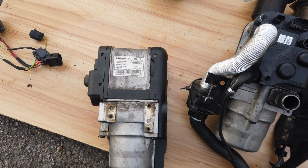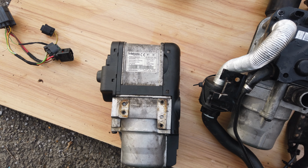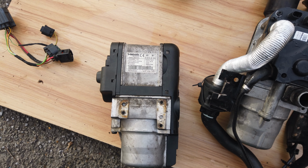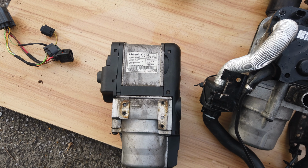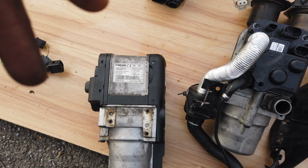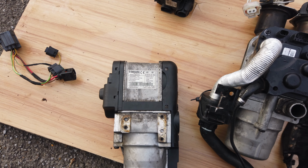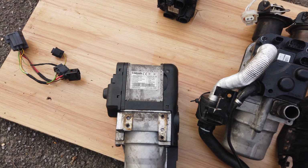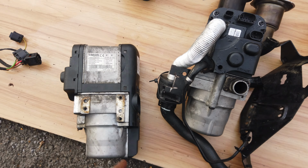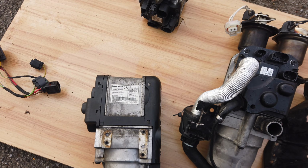Now in this situation the engine is already running, so the heater doesn't need the heating independent circulation pump. It depends on the car's circulation pump, which circulates coolant around the heating and into your radiator and into your engine block. But in parking mode, if you turn it on, because your engine is off, the heater relies on the circulation pump to circulate coolant around your engine block.